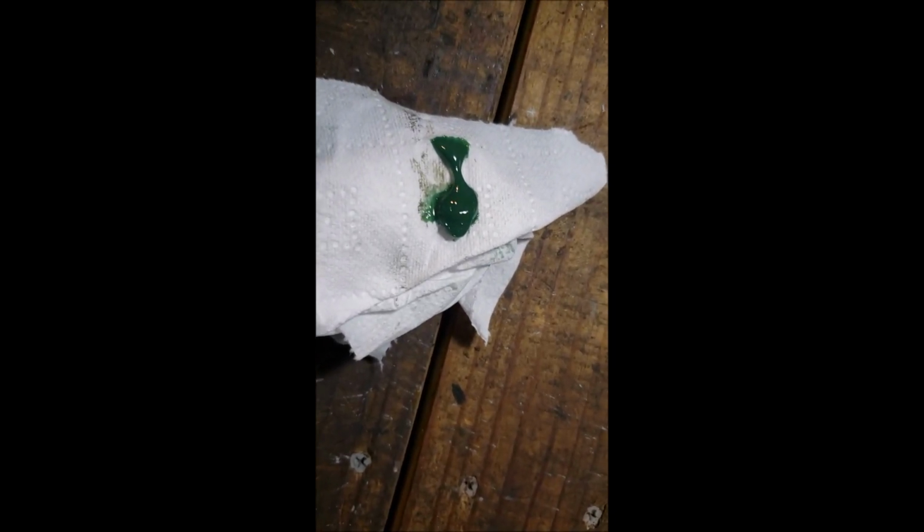I don't know, 10, 12, 15 years ago, I started using, I think, was it the 3M, the synthetic one that was red? But then I noticed after like a month of sitting, the amount of separation was way, way, way more than you get with standard grease. And I wasn't comfortable with that. Which is an issue with synthetic. It's one thing if it's engine oil and it's being stirred up every time your motor's running, but I'm just not a fan of synthetics that are basically just sitting, other than the wiggly movement. But that's just personal preference.